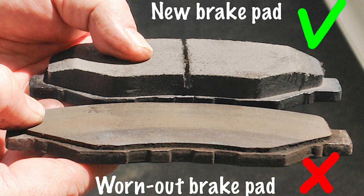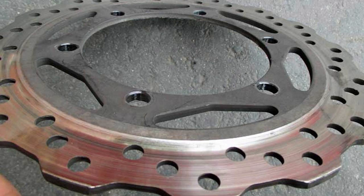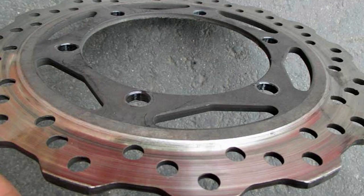This will end up wearing your tyres unevenly. Or, this person likes to use their front brake and not so much their back brake. You can tell because the front brake is almost worn out and it is starting to bed into the disc. It's not legally required for them to change it yet because there is still some pad left, but it will be an advisory. I would suggest they change the disc on this one as well because it has started to bed unevenly. The back wheel is worn but the brake pads on the rear aren't. The front tyre isn't worn and the brakes are — so they use those front brakes more than the back ones.